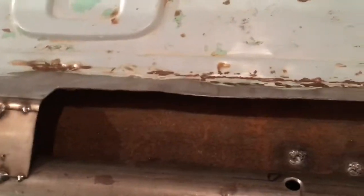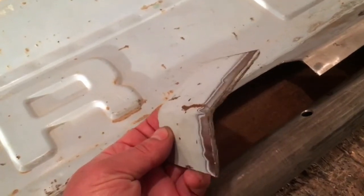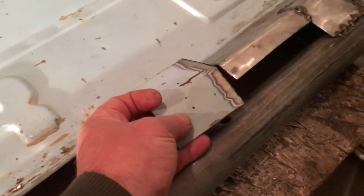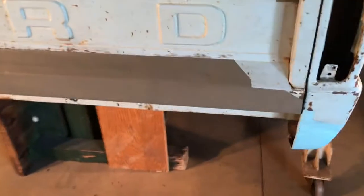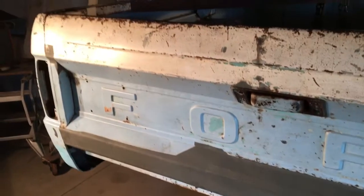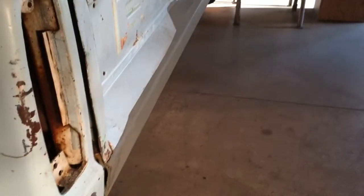There are all the filler pieces. I've got a big dent over here, holes to fill where they pushed the dent from the other side. For the corner piece it kind of worked out good — I've got these chunks out of the bed right up at the top where it bends, it's got the same bend radius, so I'm cutting those out and using them for patches where I went up over the angle. I've started tacking the back on, got that dent pulled out. Not gonna be all that pretty but it should be functional. I have it back mounted on the truck with some etching primer on it for now. It's obviously not going to be a show truck, but for what I'm doing I'm happy with it — it's very solid.